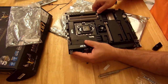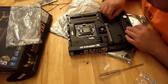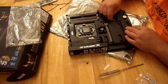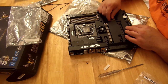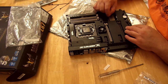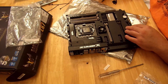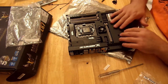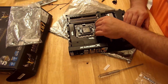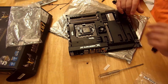Right there we've assembled the board. They're a little sneaky — I hate when they do this — there's a protective film here to protect against dust or the ASUS logo. The problem is, if you overclock and everything, you can melt that. So you want to pull that off before you install the board. Melting it's probably not going to do anything too bad, but still — just because.